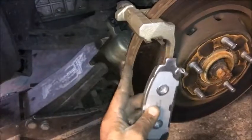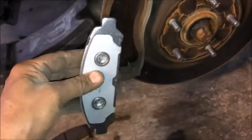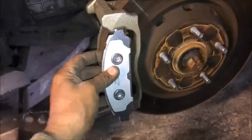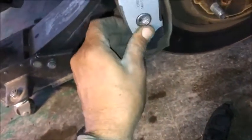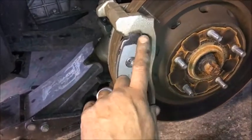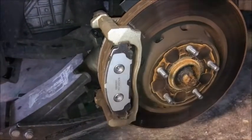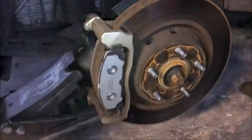The brake pad that makes the squealing noise goes towards the back. You can see how it's rounded to match the rotor — there are a couple of small clips it sits in. Stick the top in first and it'll slide a little bit easier. The rounded side goes with the smoothest side of the rotor. If you wanted to, you could put a little bit of grease around the circles and the tab itself — that stops the squealing when you stop. A lot of times it's just dirt and you just need to clean the rotors.